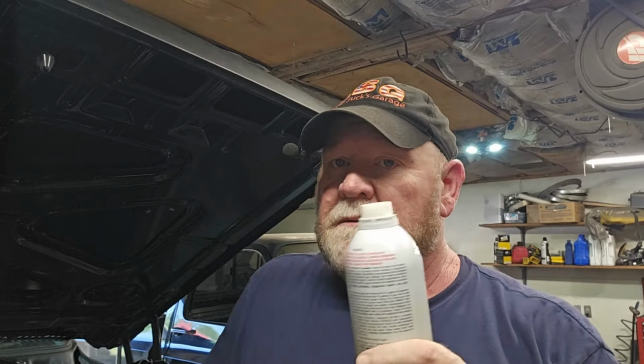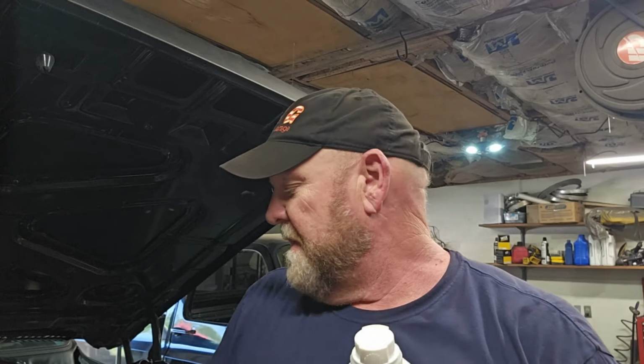It completely threw me for a loop. I really thought I had an ignition problem, when it turned out that the float level on the carburetor was low and I ran out of gas. And when you run them out of gas, you end up moving junk around. So you saw me give it the taps and get that seat set where it's supposed to be. And always use a rag. Don't ever just let raw gas seep onto the manifold.